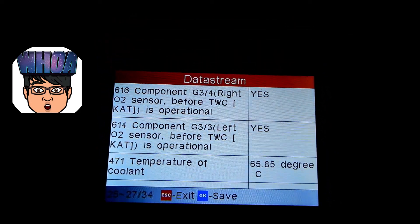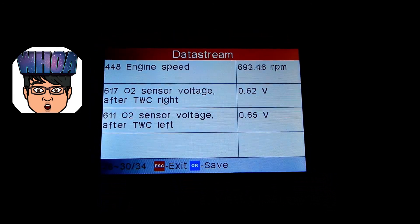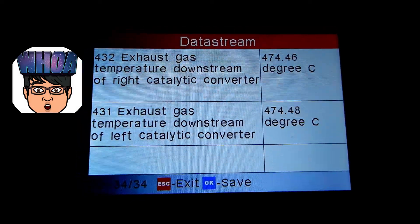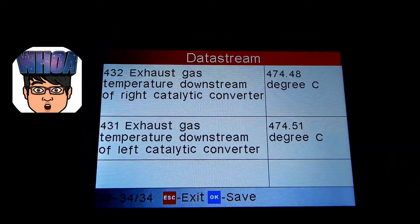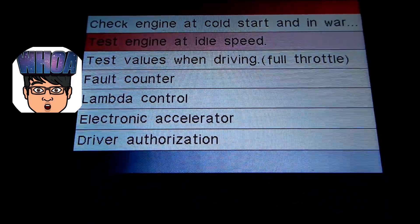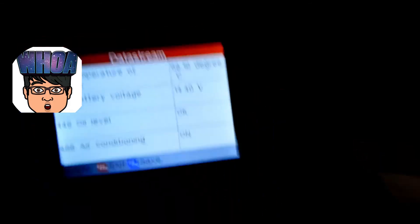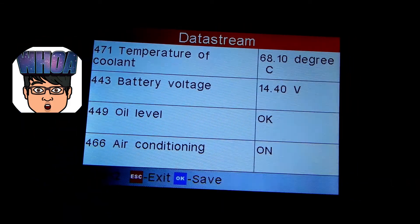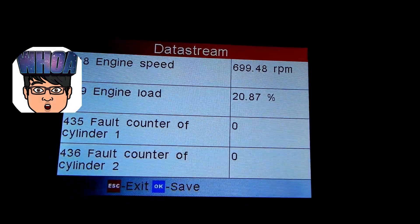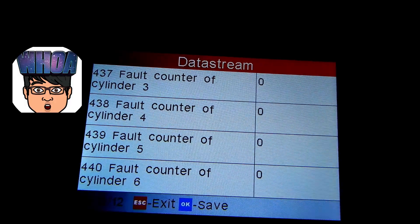You can also see the O2 sensor voltage on both the right and left sensors — that information is just priceless when trying to find the source of a problem. For instance, if your catalytic converter wasn't working, it wouldn't be able to sense it and would tell you where the fault's coming from — that's what I mean by narrowing it down. There's also the fault counter, which tells you how many faults are in the car at the moment. And here you can see engine load, engine speed, and fault counter for each cylinder — meaning if you have any misfires it will tell you. Six cylinders, none — that is beautiful, that's what you want to see.